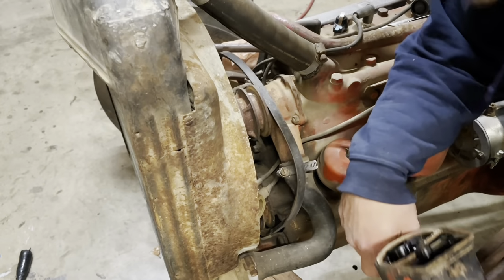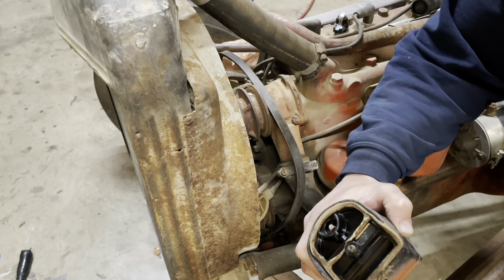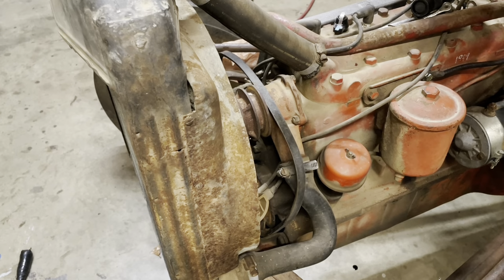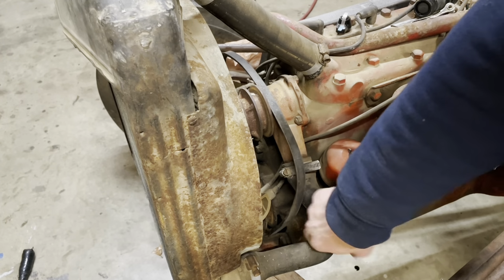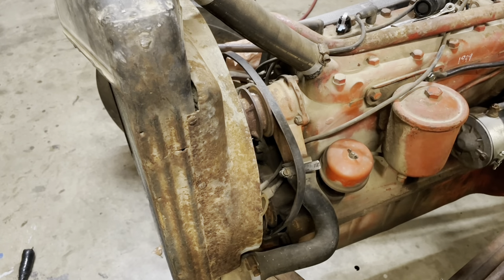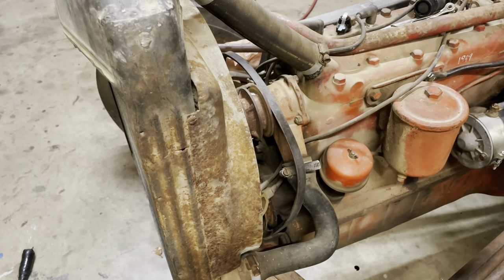So I'm gonna have to do some digital work here, because you cannot shoot 12 volts to a 6-volt coil unless you want this thing to explode in a pretty short amount of time. I wanna see if the engine will spin with the starter. So, all right, I'm gonna hit the switch here, and you're gonna watch that there crank pulley. Nothing's gonna happen. Distributor's off, don't have no power to anything, but watch that pulley there, see if she spins.